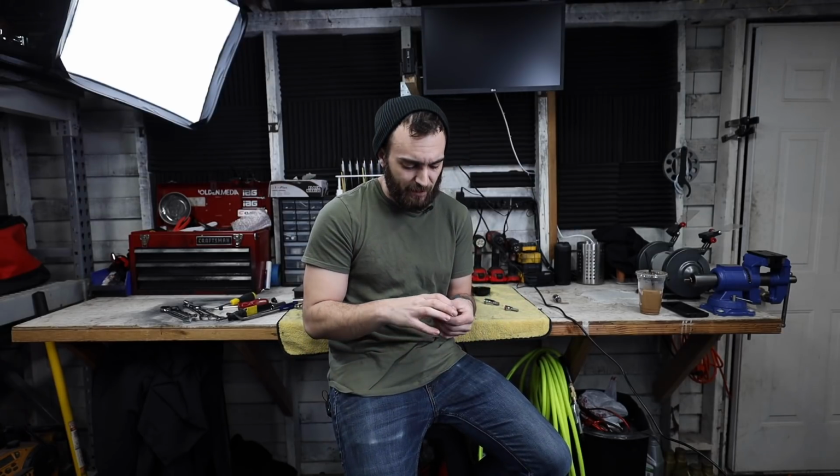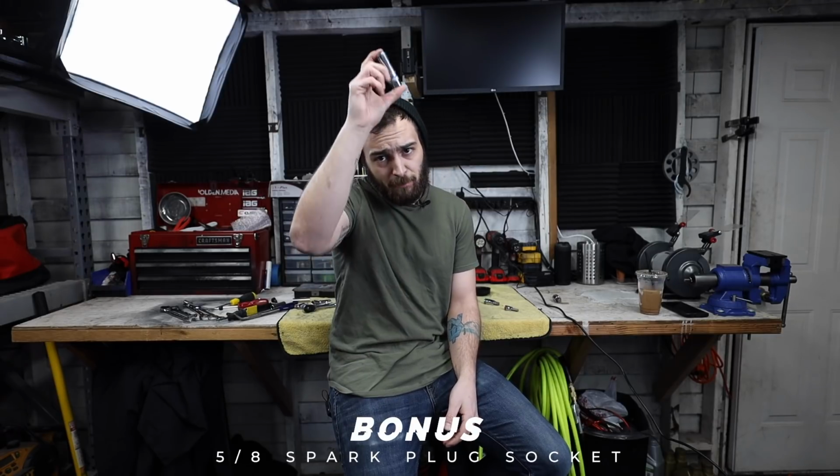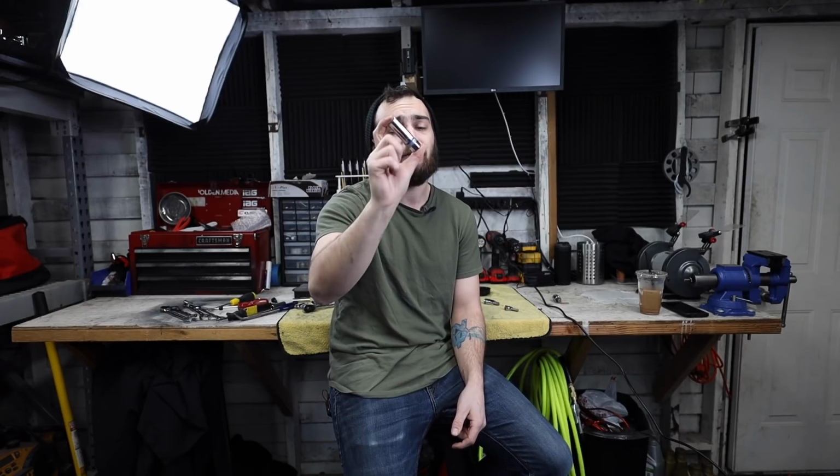And then the last kind of specialty tool that I have here is a 5/8 deep socket for the spark plugs. If you are wanting to do your own spark plugs, I highly suggest getting one of these because it does make life a lot easier. This thing has made it through like 9 different of my Subarus that I've had, and it's always been a champ at pulling out those plugs. But with that, that's all I got for you guys for these tools.